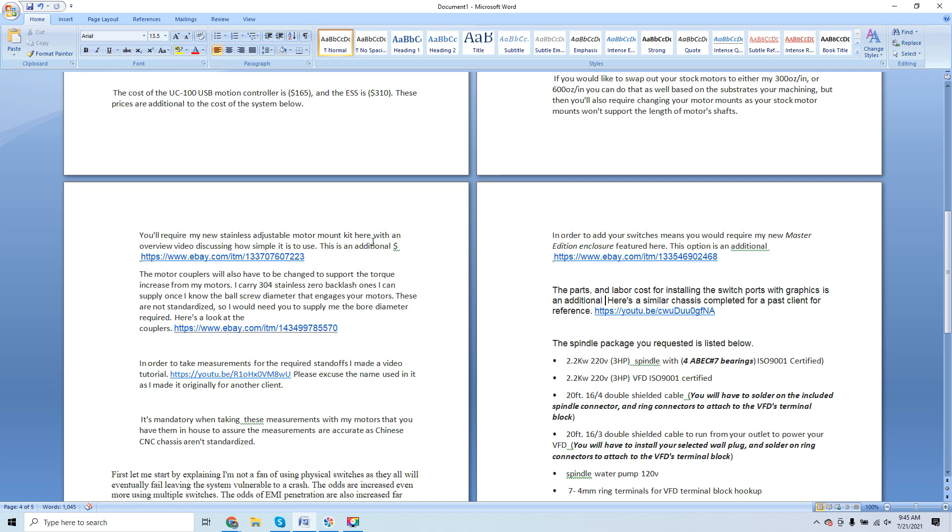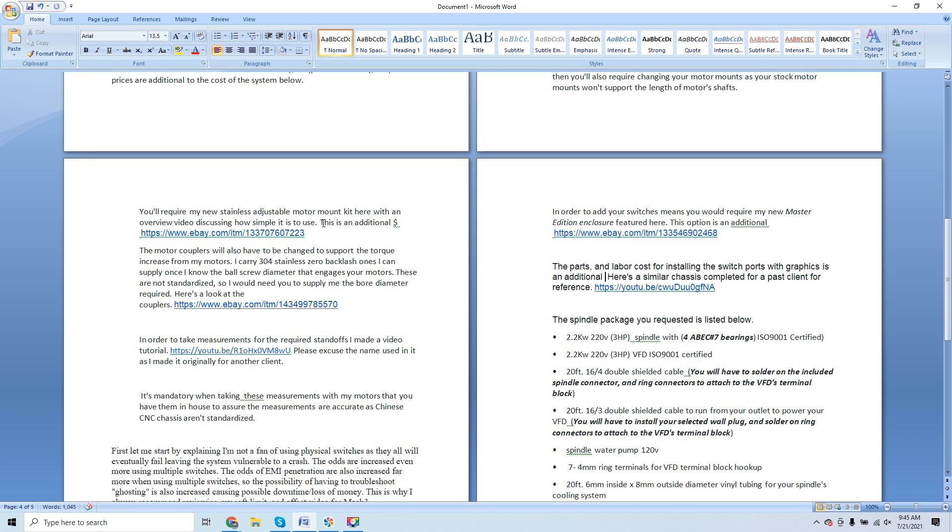I've designed new stainless steel adjustable motor mount kits. A lot of guys ask where these fit in — they fit in out of necessity, because many of you need a motor mount kit that's adjustable and made from the hardest material that makes feasible sense, which would be 304 stainless. These kits use stackable spacers in 304 stainless for maximum rigidity and give you proper spacing for your new motors. This is required whenever you change the stock motors on the chassis.